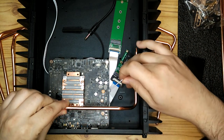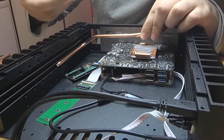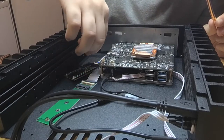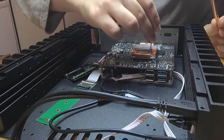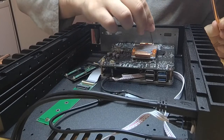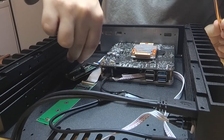And then once I've got it spread into each of the little grooves, I've also got to put the thermal paste on the wall of the case, on the heatsink part. So I just put the heat pipe in there just to help me sort of measure where I need to put the paste. I'm just using some of the excess off the heatsink there to put onto the sidewall because I had a bit too much on the heatsink.